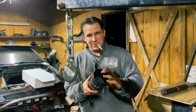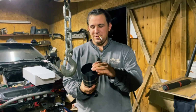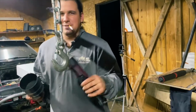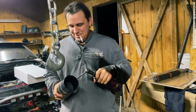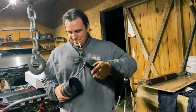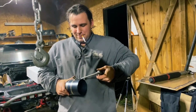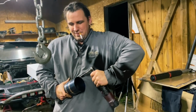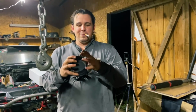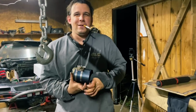So for those of you who probably at least witnessed my brother talking about piston rings, one of the things that we like to do here is screw ourselves up. Of all the things, we've got this little electric thing, and then we can't use the electric portion of it because we lost the tool that comes with the piston ring compressor. And if you're wondering if you need this, yeah, don't go to meme school on YouTube where somebody just pounds it in with a dead blow. You're gonna hurt stuff.